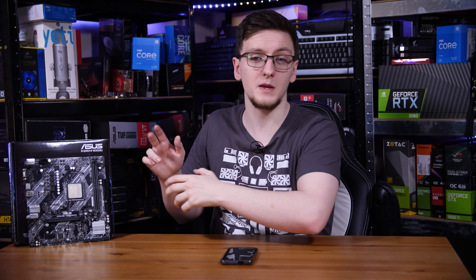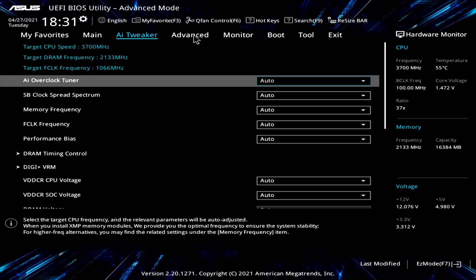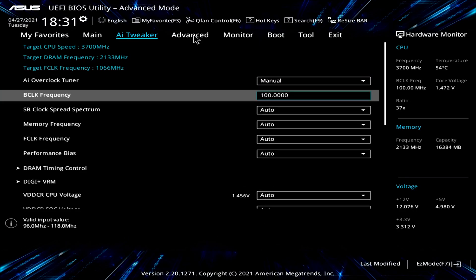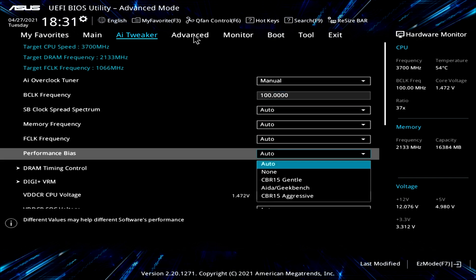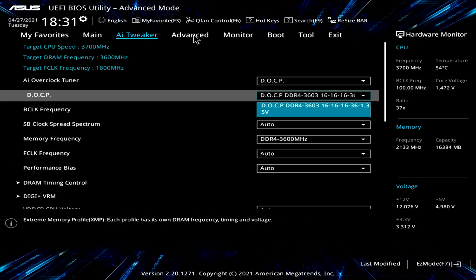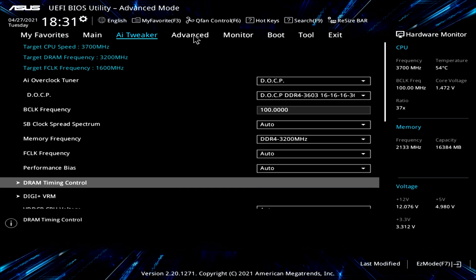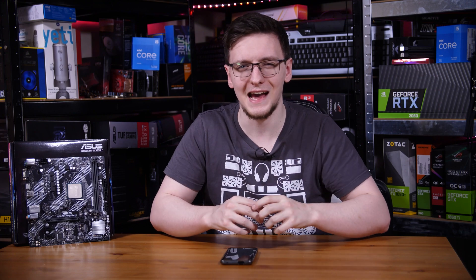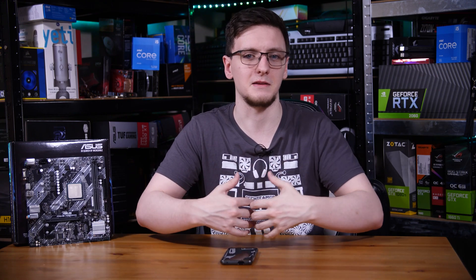The main difference between A520 boards and B550 is that A520 boards don't support direct overclocking. They do let you set the base clock frequency and memory speeds including sub-timings — take notes, Intel — but overall it's a bit more restricted. You have a lot less IO capability. AMD CPUs, especially Ryzen, are effectively system-on-chips or SoCs.